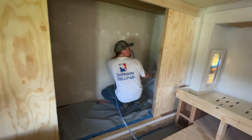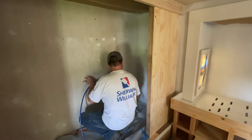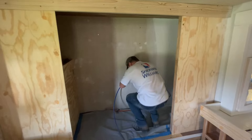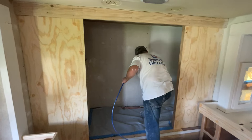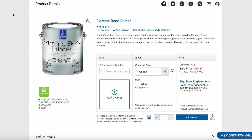So let's talk about the products we used. It's all about using the right products if you want proper adhesion and long-term durability. The primer we used was Sherwin-Williams Extreme Bond Primer. Again, we are not sponsored or endorsed by Sherwin-Williams. You need a solid primer for that paint to stick and stay stuck. When you guys see chips and peeling happening from other people's RVs, it's because they didn't prep the surface well and they didn't use the right primer. Extreme Bond Primer is the stickiest, grippiest primer you can get.